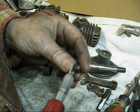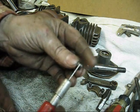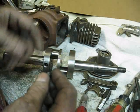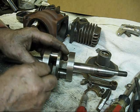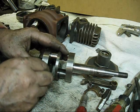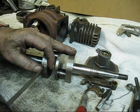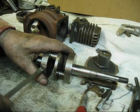I wanted to show you this - they sawed it halfway in two right there. What you do is you pinch that together with a pair of vice grips or the vise, and when you put it in the crank - I did put some oil down in there - and made sure that the governor weight is free.